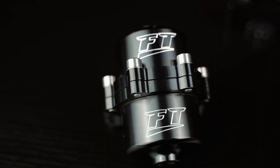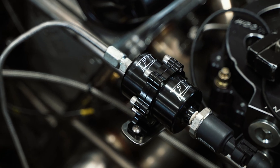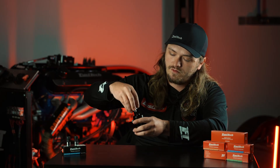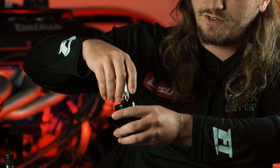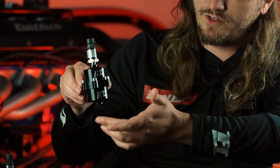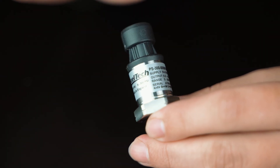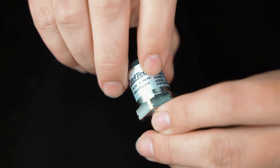If you want to use it for back pressure, we have a really nice back pressure dampening canister. It's got a nice filter element in there to help the sensor live longer and it helps smooth the reading. You just thread it in the top, use some thread sealant, and run your line from the exhaust right into it.